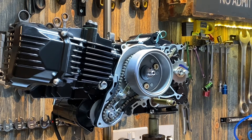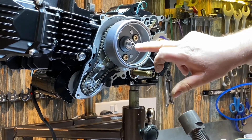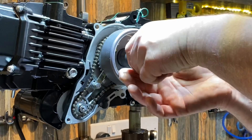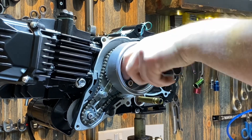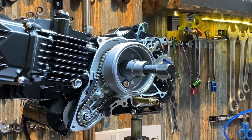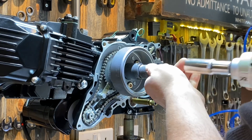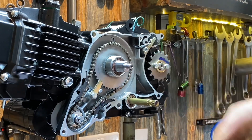Get our puller. The important thing with a puller is to grease just a fraction on the end of the actual puller nose itself, because this has got a counter bore in it and if you try and force it up too hard it ends up belling out the end of the crank. Thread the puller on till it gets all the way up, wind up the centre just so it touches, then go one turn, back it off and then again — it just comes off like that. There's no need to force it into the end of the crankshaft, otherwise it can end up bruising the end of that.